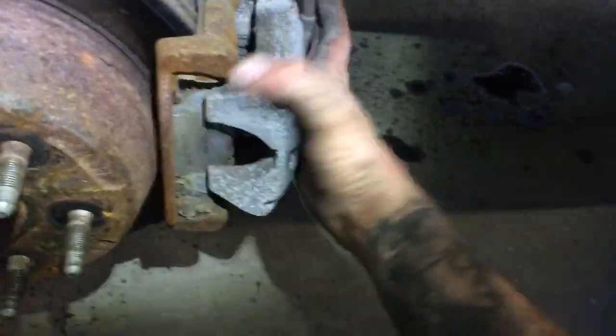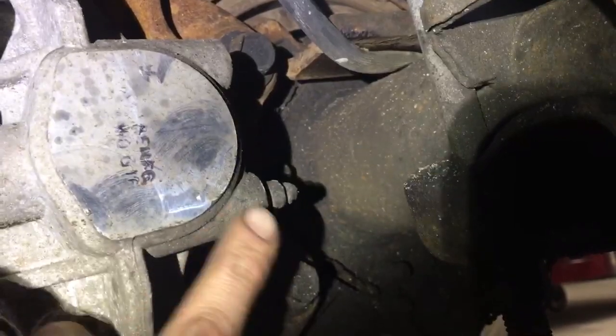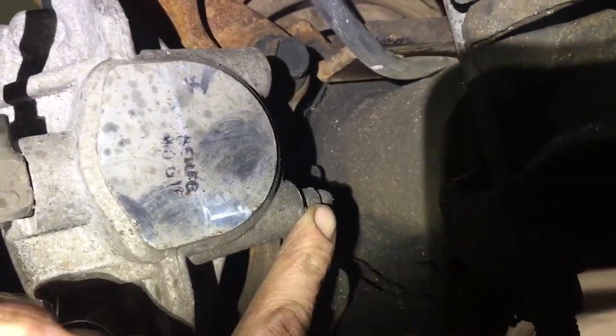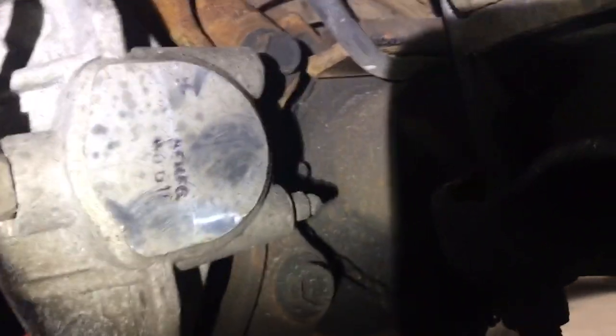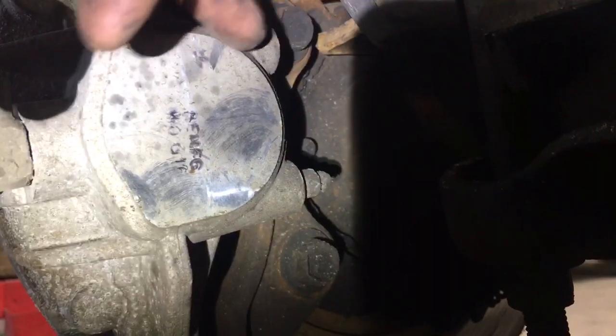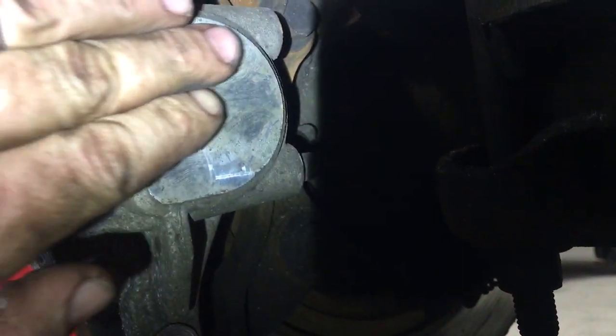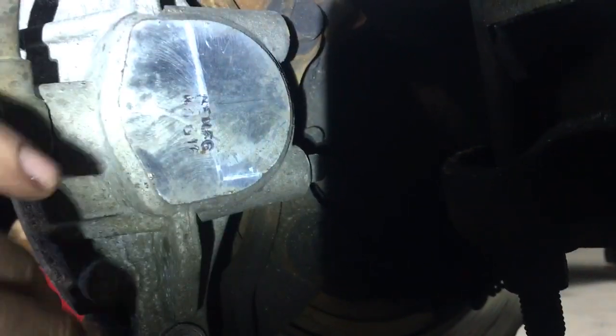Like these right now are not on the right side. If you take that off and go back here and look at the position of the bleeder screw — here's the caliper, it's right here — it's low. Bleeder screws are always supposed to be at the highest point on the piston in that little chamber. So this one is low, and no matter how much you bleed it, there's always going to be air caught up here because air goes to the highest point. There's always going to be a pocket of air up here, giving room for the pedal to push, so it'll never get firm.